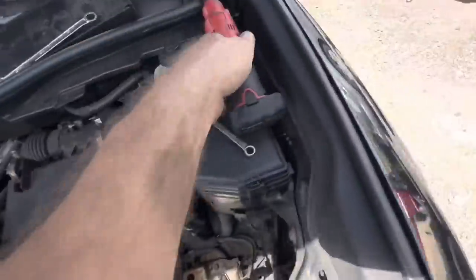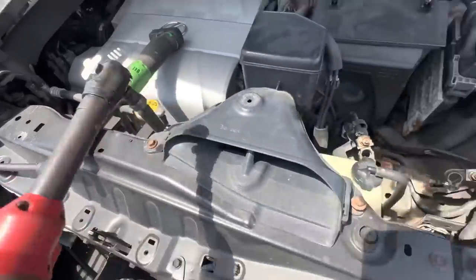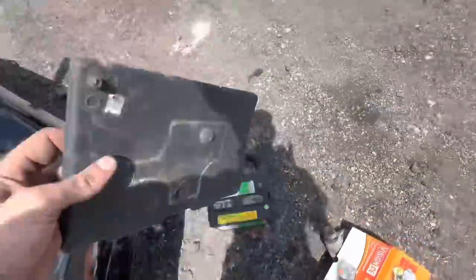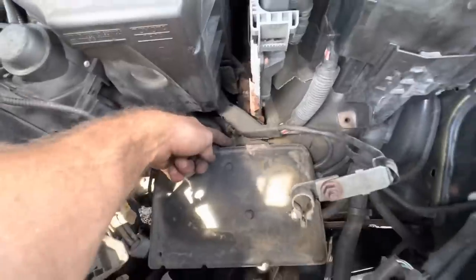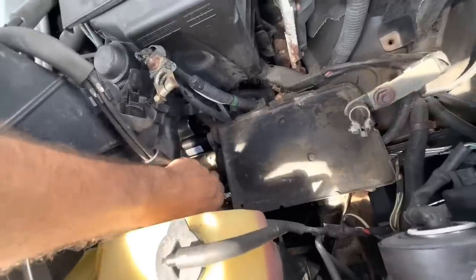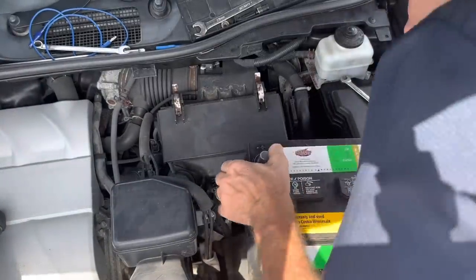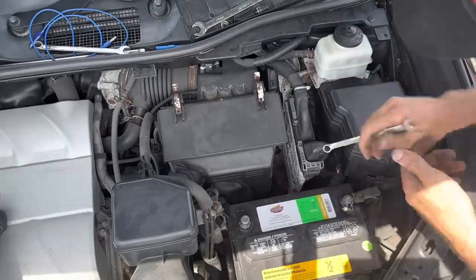Even a thread crusty bolt. There we go. Good. Okay, plastic battery tray. Let's maneuver this guy down in here. I need to find a new J-hook for that battery hold down thing. That thing was missing. That was not good. Two more super glued hoses right here. That's good, and we're looking good. Let's get the battery in the hole. Interstate battery coming in. Drop that guy down. Let's get this thing reconnected, tighten down, and then see how she cranks.